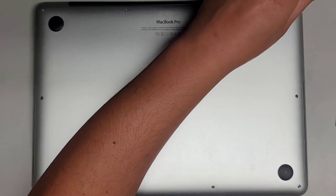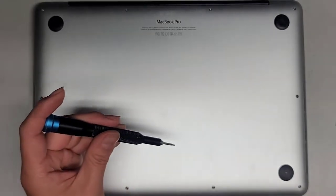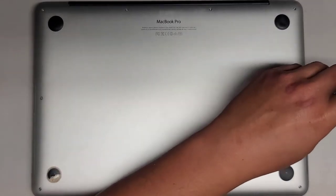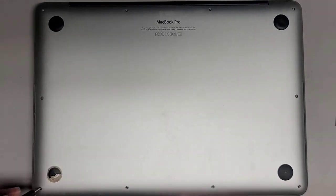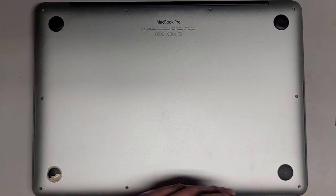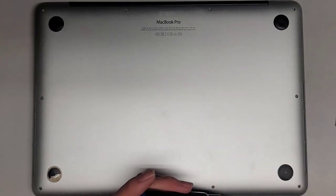This had liquid damage, so the main thing you want to do is open it up and disconnect the battery as soon as possible. You also want to make sure to turn it off. The customer did the smart thing — they flipped it upside down so the water could drain out, and hung the screen off the edge of their table with a towel underneath the keyboard to absorb any liquid. If this video helps you out, make sure to like, subscribe, and share my channel with others so they can learn how to upgrade and repair their devices.